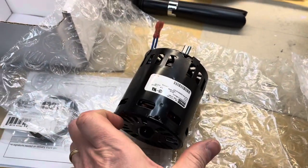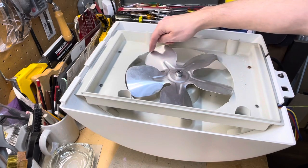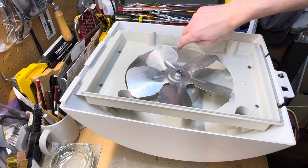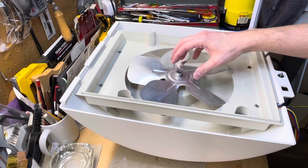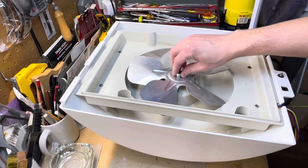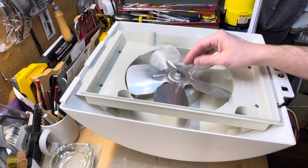Here's the motor itself. Part of the noise it was making — the motor came off balance. The fan was scraping on one side; you can see some scoring. What I had to do was take apart the entire motor after it cooled off, put some graphite lubricant in there, straighten out the fan blade, and then reassemble it. Now it actually works fairly well, but I viewed that as a temporary fix.